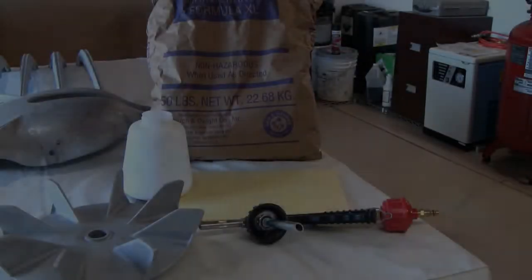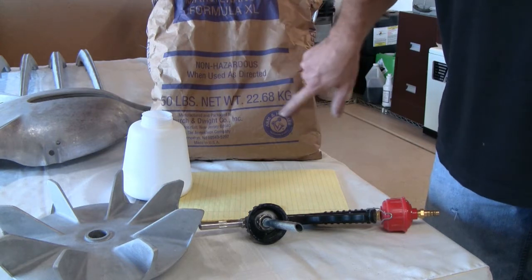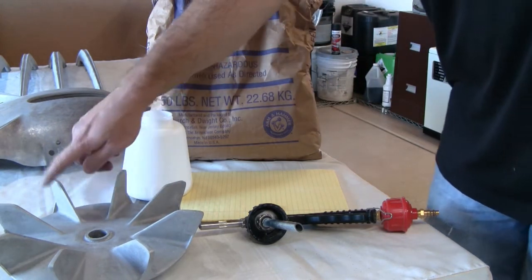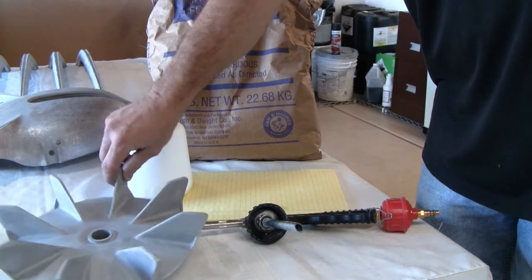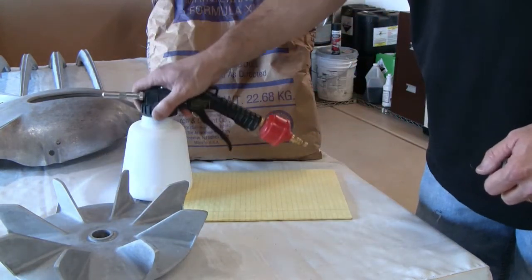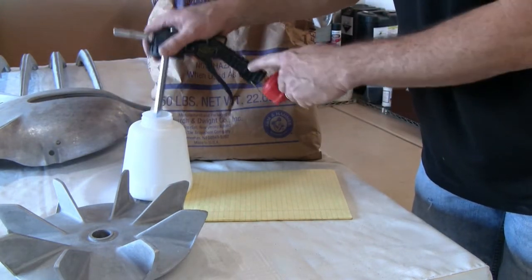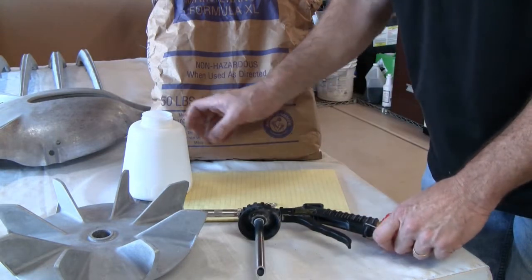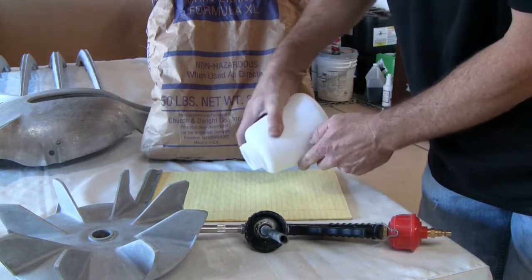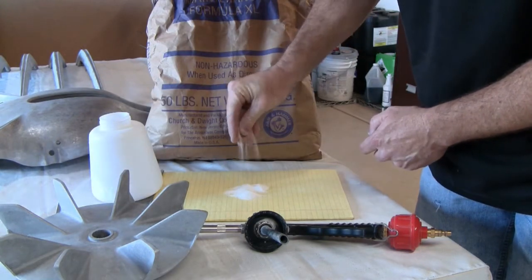Let's get started with Day 4 and get working on stripping the frame and building an oven. After removing most of the finish with paint stripper, I soda blasted the frame with heavy grip baking soda. The parts needed to be soda blasted to expose any cracks and remove the residual paint. This isn't sandblasting — that's too abrasive. This bead blast gun is not too heavy and uses an inline air dryer to prevent clumping of the soda grains.